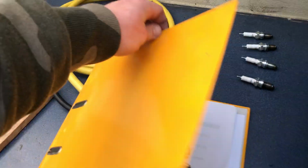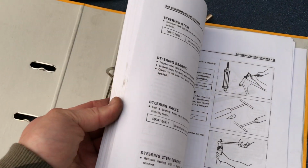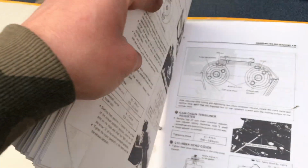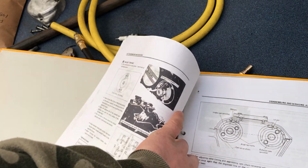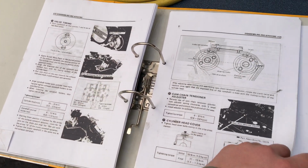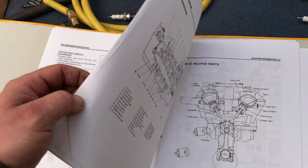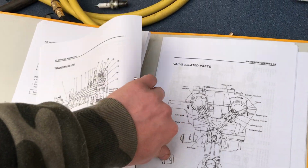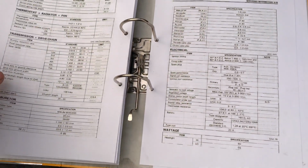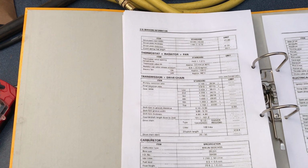So this is the service manual, and on the end, by the way, I forgot to say, spoiler alert, because I'm not there in the YouTube series yet, where the motorcycle is on and running. And another thing, everybody keeps saying you need 3 things for the engine to run: fuel, air, and compression. Well, I'm living proof that you don't need the compression, because with 2.5 bar instead of 11 to 15, this engine is starting fine and it's running, and it doesn't sound like it's struggling, so I don't know what the heck, man.